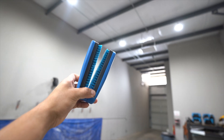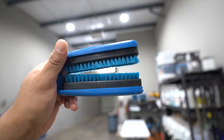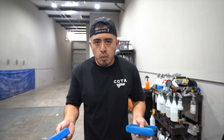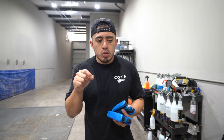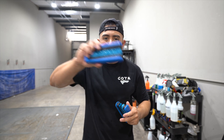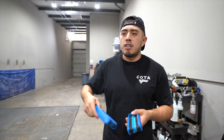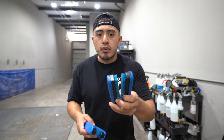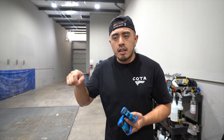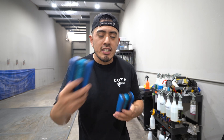Next up are these seatbelt cleaners — I think they're like $16 or $20. They do a good job for general light cleaning. When it's a very intense cleaning and it's really bad, we'll probably just pressure wash the seatbelts or use a toothbrush to get into specific areas. But these are very useful in terms of the design — you just feed the seatbelt through, clamp it, and move it up and down. Are these the end-all be-all best seatbelt cleaners? No, but for a specific situation they can be easier and faster than using a detailed toothbrush-style brush. At least having one if you're doing a lot of interiors could help you out.